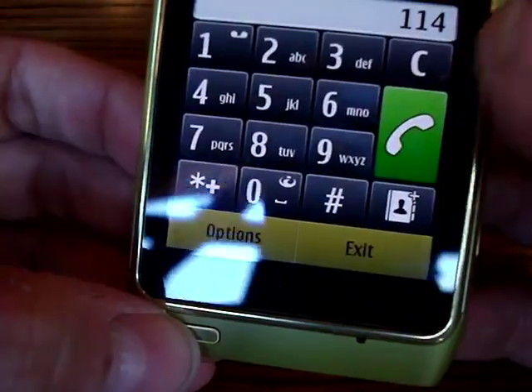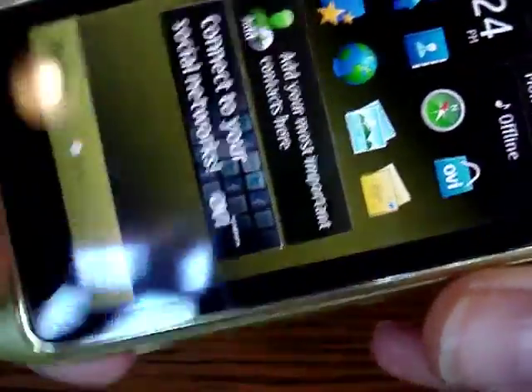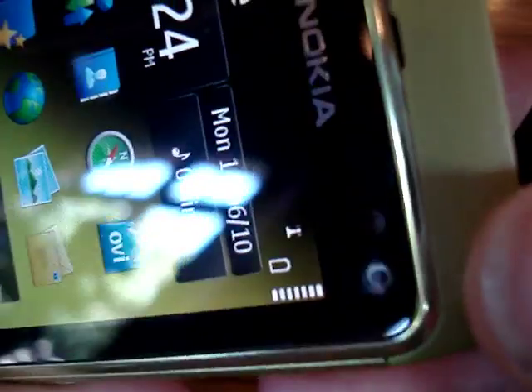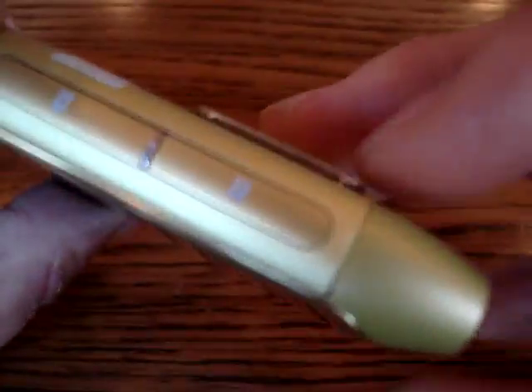There's no SIM in this particular phone right now unfortunately — trying to close these, a little hard to close, but I'll figure it out — there we go. On the front here you have the Symbian button which brings up the menu and goes home, a microphone, the OLED screen which is an nHD display at 640 by 360 pixels, a front-facing camera, and the sensor to detect that you're putting the phone to your face.